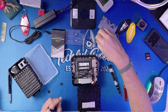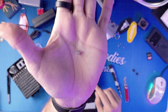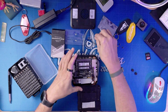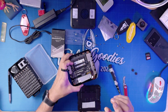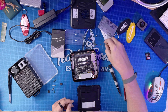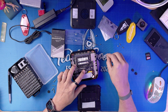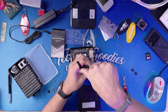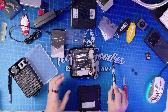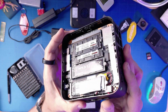So the package has a standoff that would screw into the board if needed, but there's already a standoff on the board here — that's what lines up with the slot and holds the drive in place when you push it down. There are also smaller screws to screw down the NVMe. I'm going to push this down, screw in the screw, and that's it — I've installed the NVMe drive.